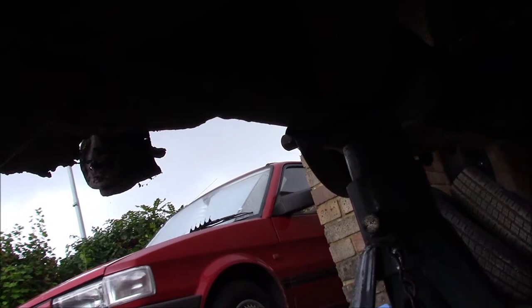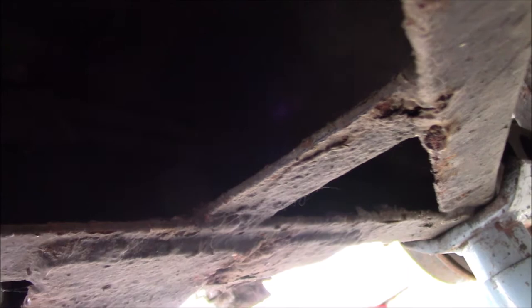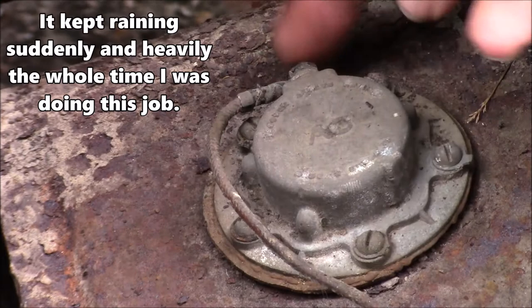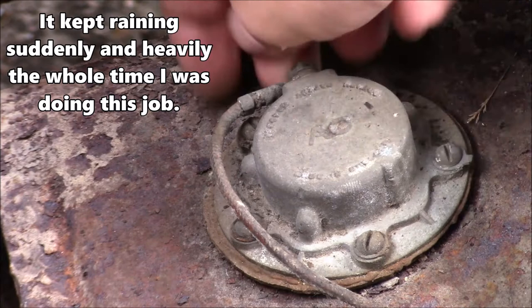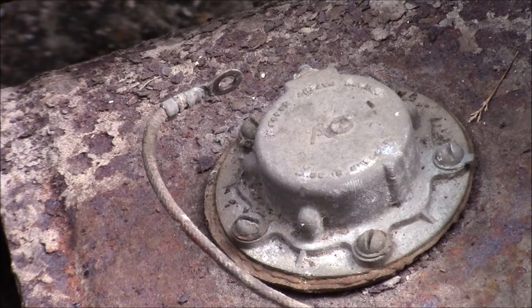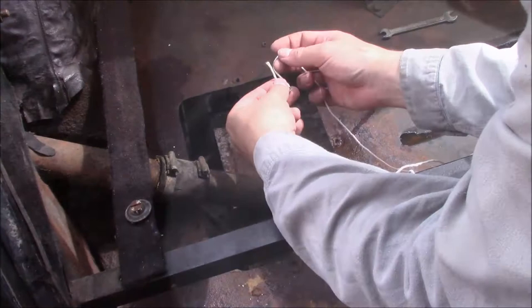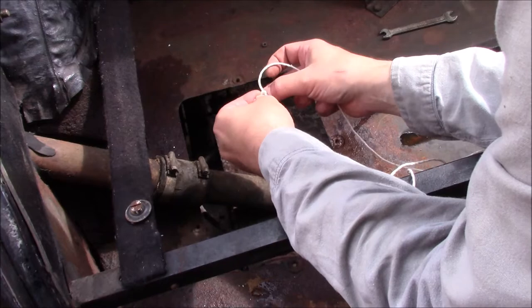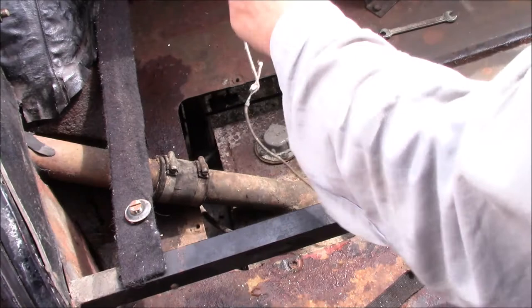Safety's important, so axle stands on the chassis there. We're getting there. One downpour out of the way. I've just cracked this nut off here, and this is for the fuel sender. Disconnect this to put the new wire through. Before I pull that wire through, to make it easier to route the new one, tie some string on. That just means as I pull it through, the new wire will follow the same route. It should in theory make it easier to put the wiring back through the chassis as well, so I'll be using the same technique.